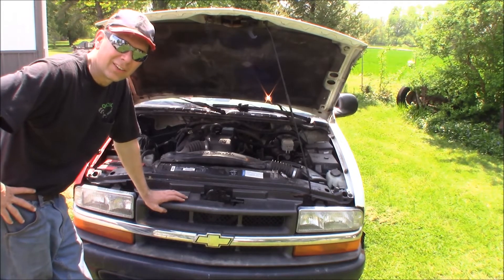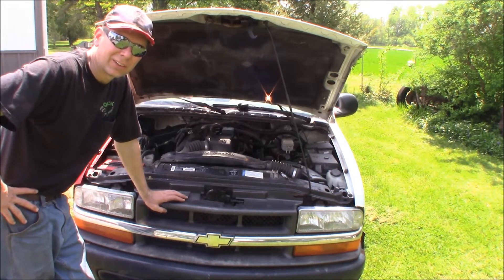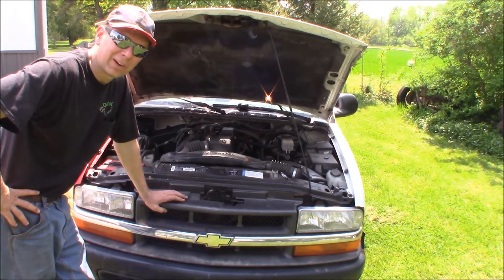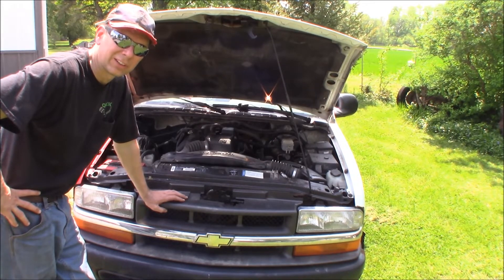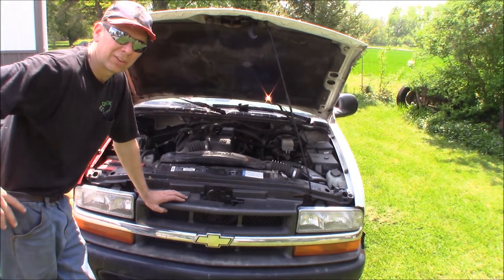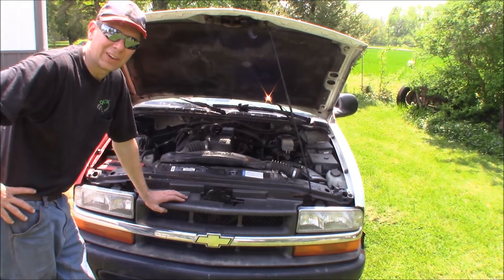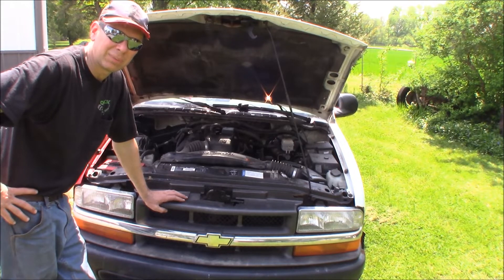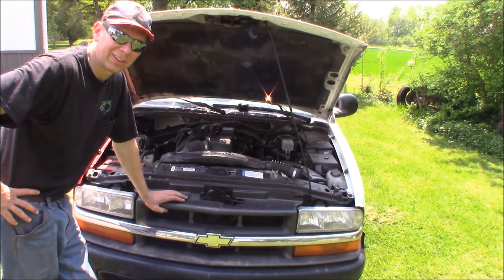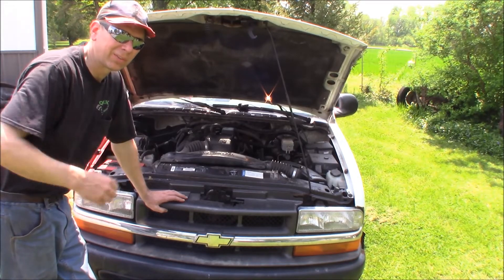Now, these engines tend to lug. They put a real serious wide-range third-to-fourth gear deal in the tranny, so it really lugs it in overdrive. And it kind of wore the main bearings, I think, and it had lower oil pressure cruising — like below 30 pounds or so. So instead of running 5W30, which I'm supposed to, I'm running 10W40, and it bumped the oil pressure up a little bit. I run around in third gear below 50 miles an hour to keep the RPMs up, because this thing's a bog monster if you lug it too much. It's uneconomical and has no power when it's bogging, so I keep her in third up to about 50 miles an hour, then drop it into fourth for overdrive.